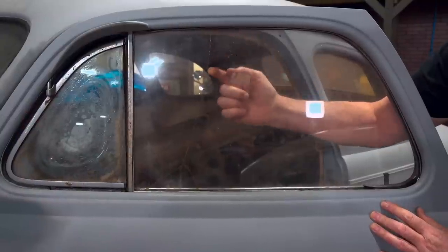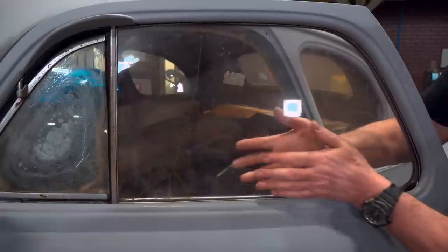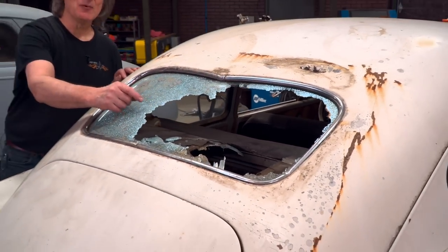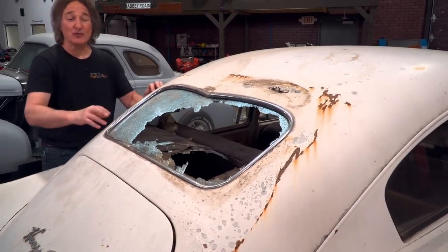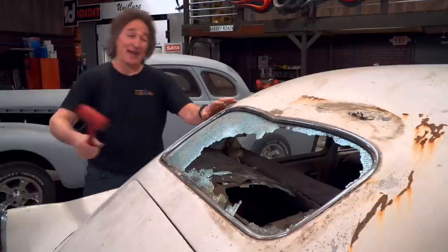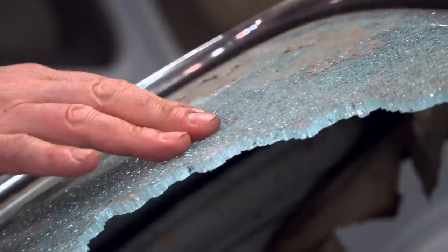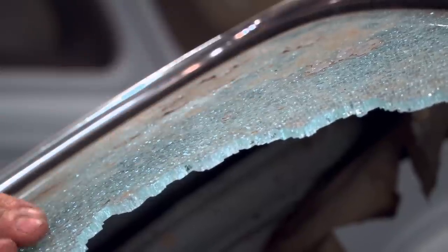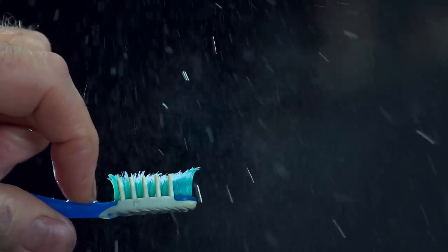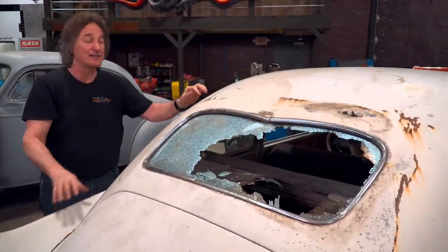If the glass is just cracked, your best approach is to just cover the whole window on both sides with tape, then you can lift the whole mess out in one piece. However, if some of the glass is broken out, the rest of the glass also needs to be removed, or it's just going to go everywhere when you start trying to pull out that rubber gasket. Before you just grab a hammer and start banging on it, remember — there is built-up pressure in broken glass. It's kind of like a spring. And if you start banging and twisting on it, glass is going to go everywhere, kind of like water off a toothbrush, and those glass shards are going to be laying everywhere — on your arms, on your face. Not a good deal.